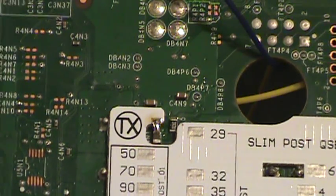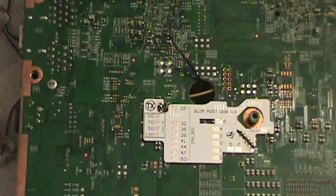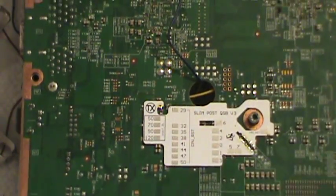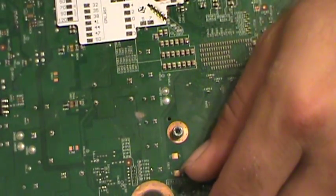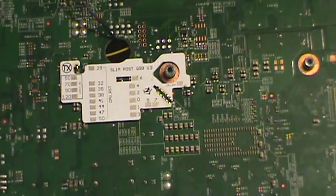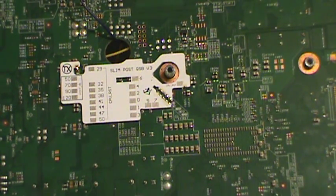Like I always say, take a q-tip and clean up after yourself. I'm going to have to change the thermal paste on this again since I broke the x-clamp off — it took loose and then I moved the board around a bunch. Go ahead and take a q-tip and some isopropyl rubbing alcohol and clean up all your little pads there.